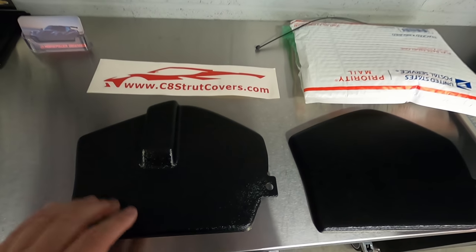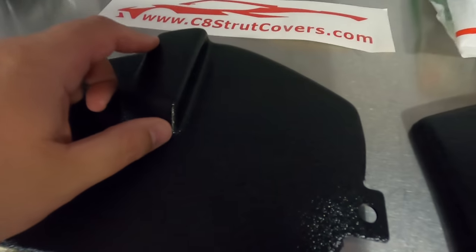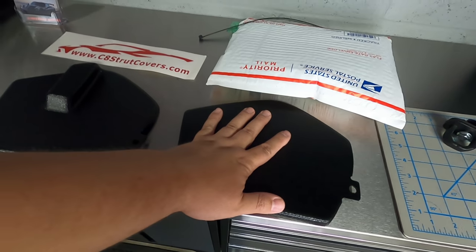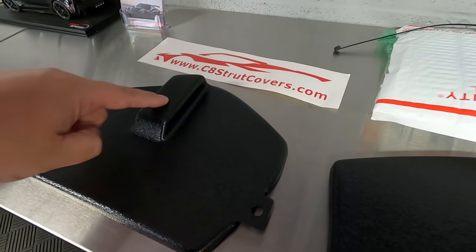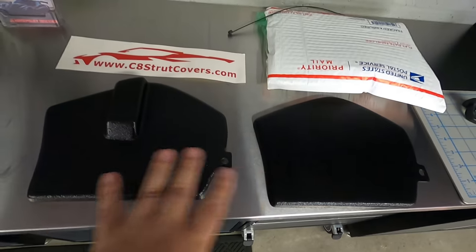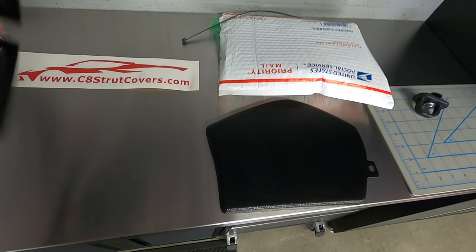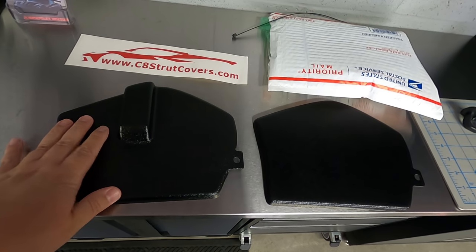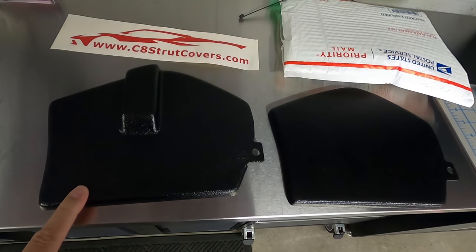I want to give you a quick look at why there is a difference between the MagRide and the non-MagRide version. As you can see, there is a little cup on the MagRide version, whereas the non-MagRide is completely flat. The flat one will sit right on top of the strut mount, while the MagRide version has just a little bit of elevation to allow the MagRide wire to exit off the top of the strut without pinching it. Pretty simplistic — nothing to break, nothing to go wrong. These are ABS plastic, so they're not going to rust or corrode. They're just going to stop water from entering into that strut mount.